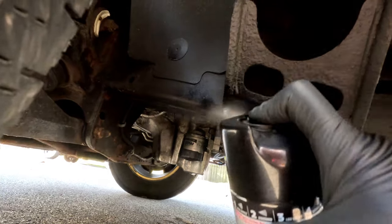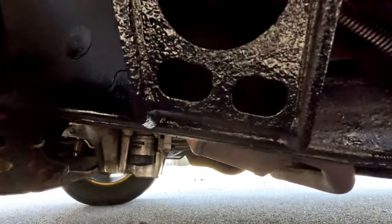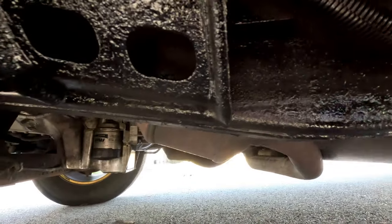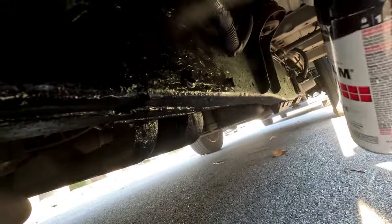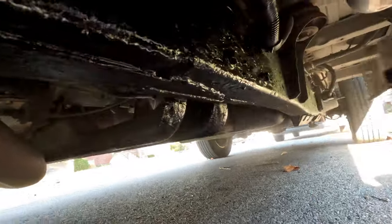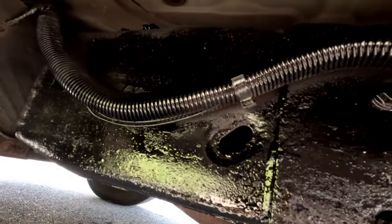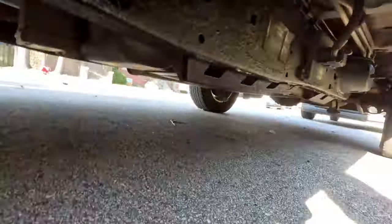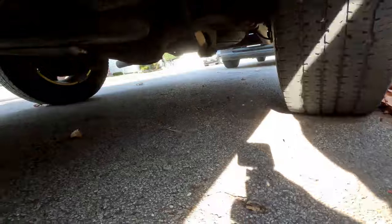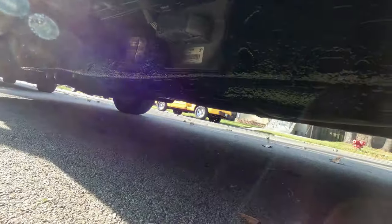The wind's blowing back in my face, but I'm still starting from front to back. I did the front when I had the front tire off. See that — it looks amazing already. This is a gloss so it's going to dry gloss, and this is what protects the primer. If you want a really good top coat, top coat it with an automotive gloss — it's really solid and durable. The wind's blowing right back in my face, it is a super windy day. That's what my frame's looking like right now. Looks pretty sexy.